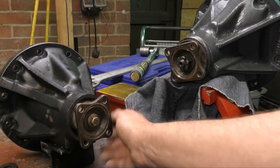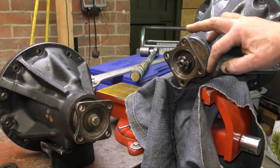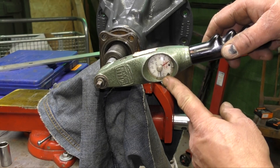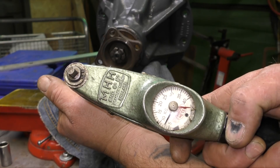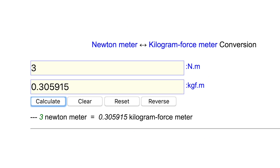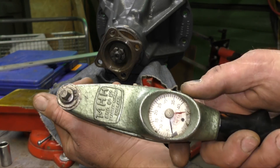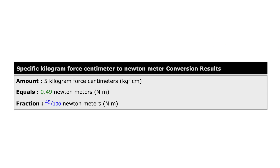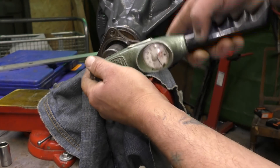It should be smooth to move — just a light bit of drag. You push it around your finger and it feels good. There's no short-cutting here at all — you have to clamp the nut up. I've got a gauge here that registers in kilogram force. Land Rover recommends something like this, but to buy one they're quite expensive — I wouldn't expect you to have one in your toolbox. According to Google, 3 newton metres is 0.305915 kilogram force per metre. Luckily, this gauge is in kilogram centimetres force — 5 kilogram force centimetres equals half a newton metre. So I can go up to at least 15 kilogram force centimetres for bedded-in bearings, or 30 kilogram force centimetres for new bearings.